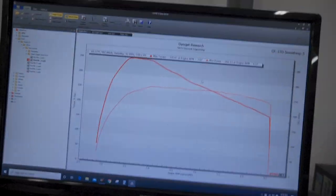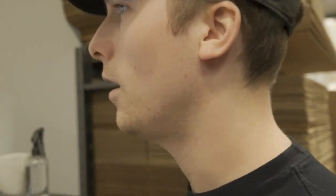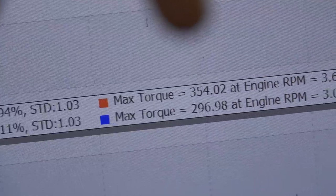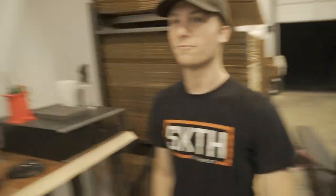How'd we do? Much more spicy — almost 360 wheel torque and 266 horsepower. These cars don't hold boost up top and I didn't add any timing up top in the tune, so this is stock timing. Stock intake in blue: 296 torque. With a tune: 354 torque. 266 horsepower with tune, 258 without. Now we swap the intake.